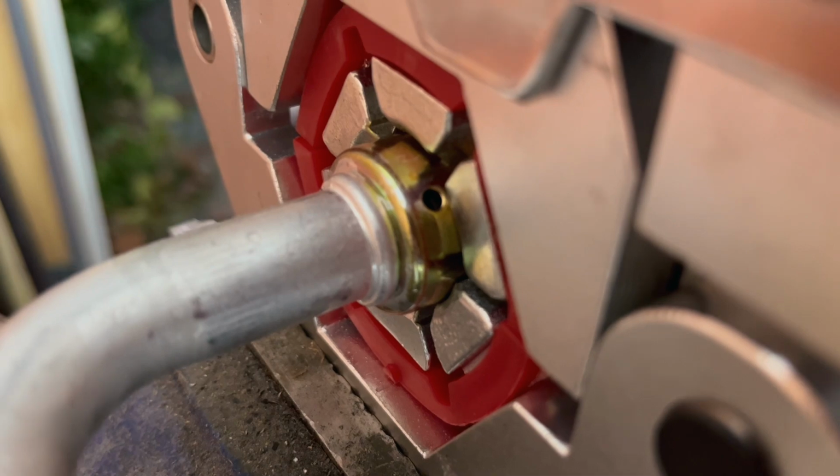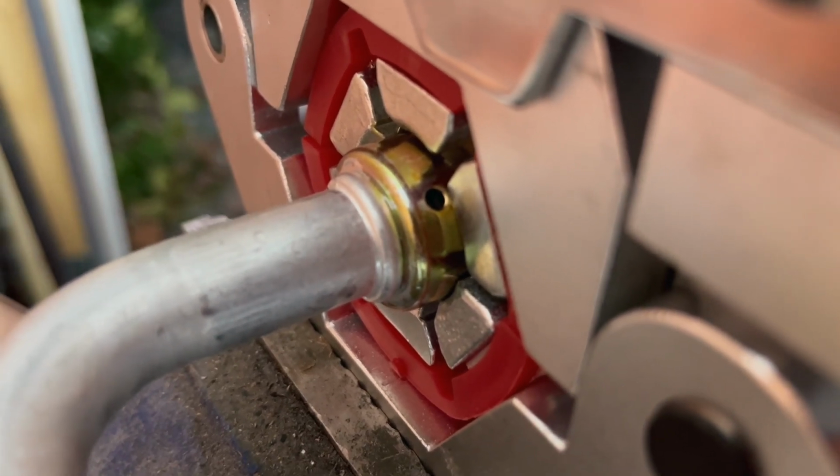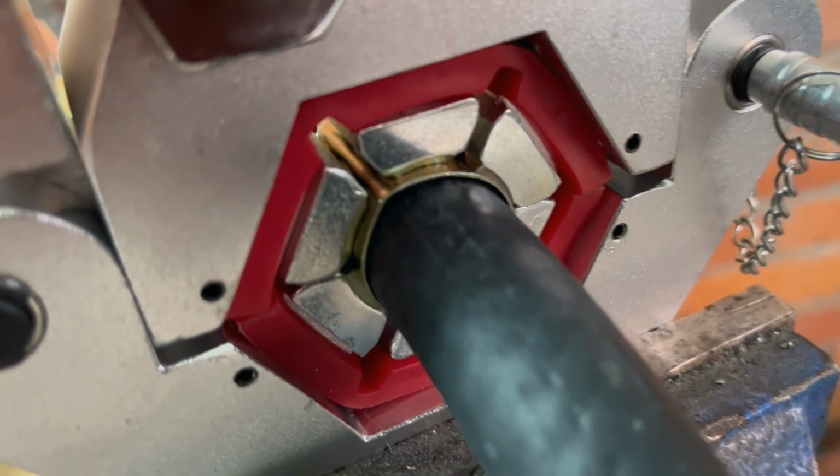I went ahead and bought an AC crimper because the last time I had a shop try to crimp these, they just absolutely destroyed them and basically said, sorry, this isn't the right fitting type. It is, just don't be an idiot. But the process is pretty straightforward. Go ahead and load the fitting in and make it so it sticks out the same on both sides. And shove Black Mama deep inside there, all the way. And then go ahead and start the crimping process.